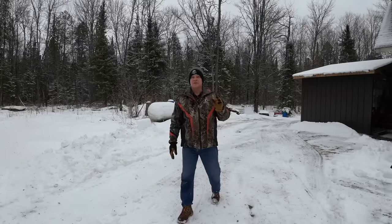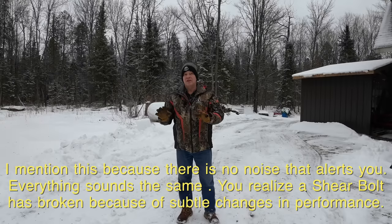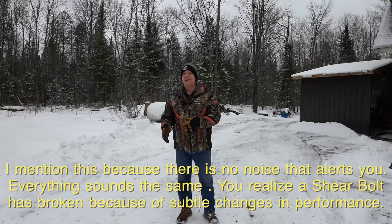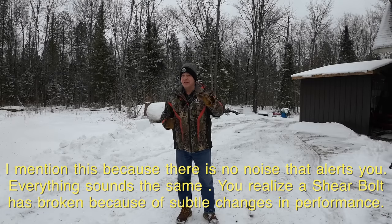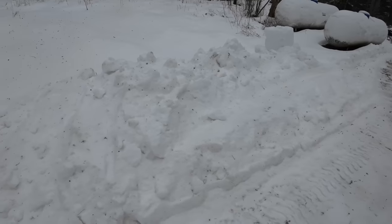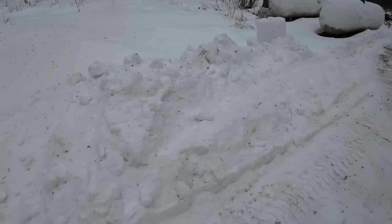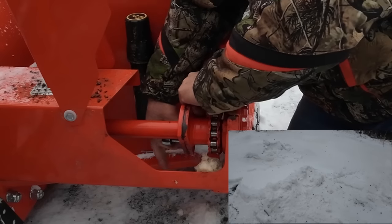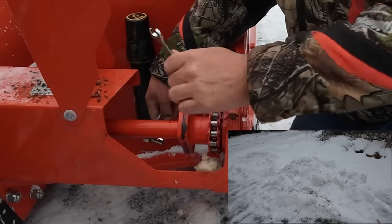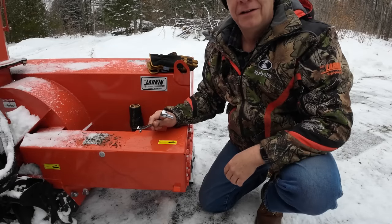So how could I tell so quickly that there was a pin busted? Because when I started pushing that blower, I noticed that I had snow coming out of the chute, but based on what I was seeing on the ground, there was a lot less snow coming out. So I knew something was fishy. On top of that, as I kept pushing the piles, it was like I was plowing it — there were big chunks of snow left at the end of the push, which tells you the snow is not getting ingested and going through the augers. It's just being pushed forward.